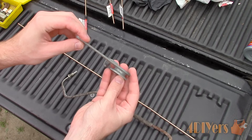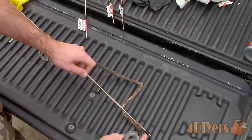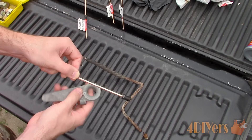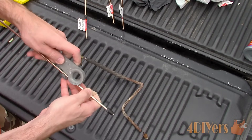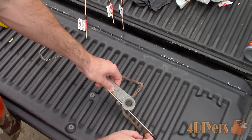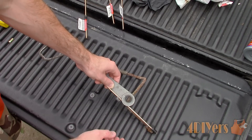First I'll start with bending. There are various types of benders available and it's best to use one so you don't risk kinking the line. I'll match up the old and new line, place the line in the bender in the correct position, and continue to bend. The dies prevent the line from kinking — apply pressure on the sides maintaining its rounded shape. Use one hand to hold the line and the other to apply pressure closely around the radius, as holding further away may deform the line further up.